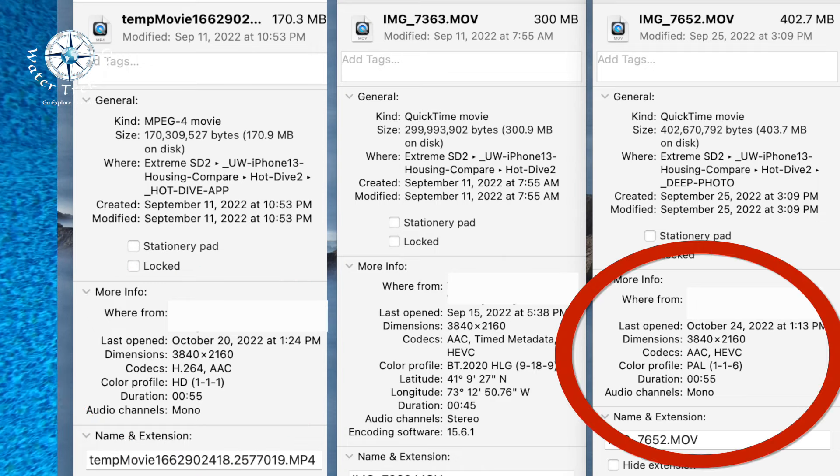A bigger issue is the anti-fog film — it's already scuffed, not from me trying to clean it, but from normal everyday contact with the phone. It only took two dives. Additionally, I got fogginess in every test video. I need a desiccant — so what's the purpose of the vacuum? On average in my tests the water temperature was only 72 degrees, yet I had the same results with both apps. It turns out it's the anti-fog filter that's creating the fog. I then tested both my iPhones outside the housing and then inside the housing, shooting the same messy workspace. The Hot Dive video had a distinct haze, especially around lighting. I contacted Hot Dive on how to address the anti-fog issues — can I remove the film, replace it, how do I fix it? If it's permanent, how do I use this housing without degraded video? To date, no answer.